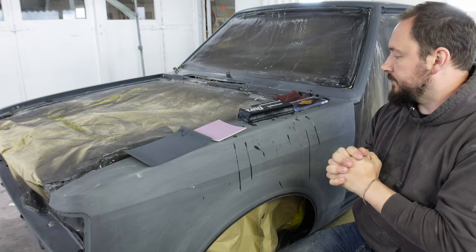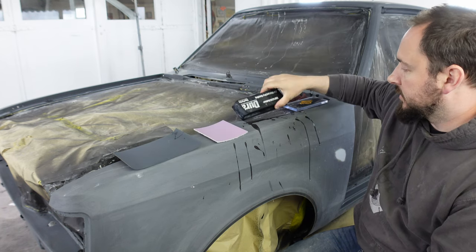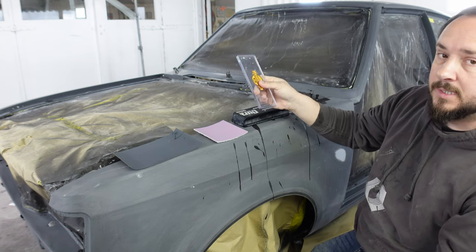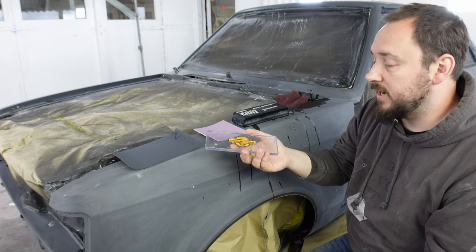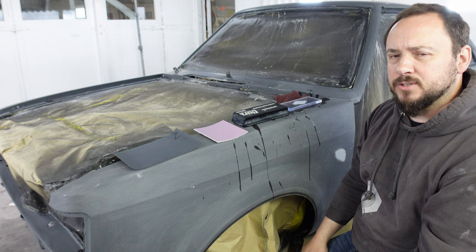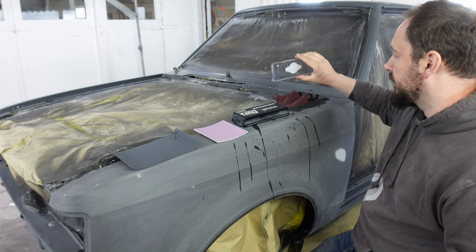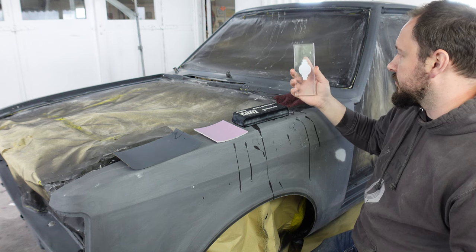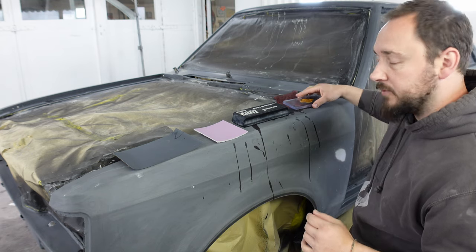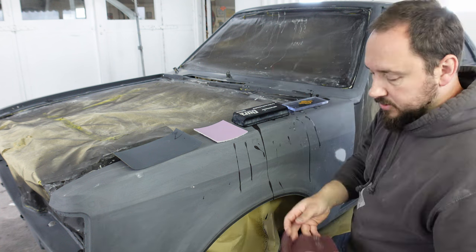For this procedure we're going to be using some 600 wet and dry, a 500 soft pad, a Dura block because it's slightly bendy to get those bendy shapes in, and one of our own bulletproof blocks. We're going to get those polished up and out to you guys as soon as possible - the wet flatten blocks are really nice, easy to work with, good for flat panels. And maybe a bit of red scotch just to finish off awkward bits.